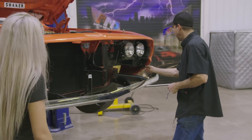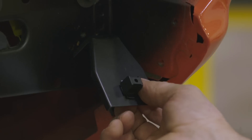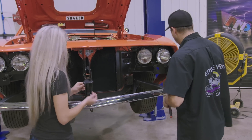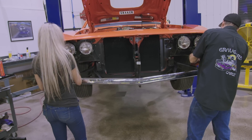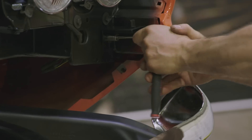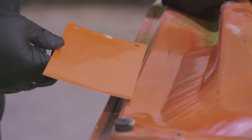So what we can do is we'll put our little retainers in here. These little deals go in that little funky hole I was telling you about — these will snap in and slide in like that. These go on a particular side. They'll spin around going upside down — there's a tab there. That tab will go into that locating hole there, and then when that one sits up, see how it's not touching quite as bad — this will work on that side. See if you can get it started. A lot of times there's so much paint in those holes that the bolt's not going to want to start too well. That little locking tab there — you can have one bolt in there and it'll keep it from spinning.